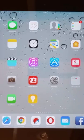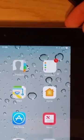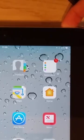Another thing you can try, very simple, is to power off the iPad fully. Hold your finger down on the button in the top right hand corner, keep it held down until it comes up with slide to power off, then swipe your finger across to power off. Leave this for a couple of minutes.